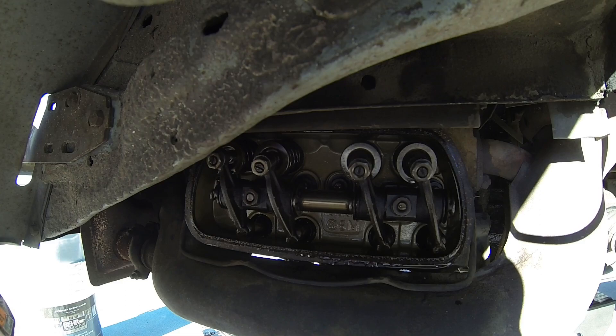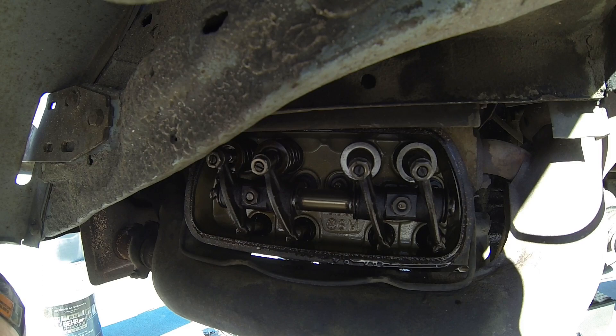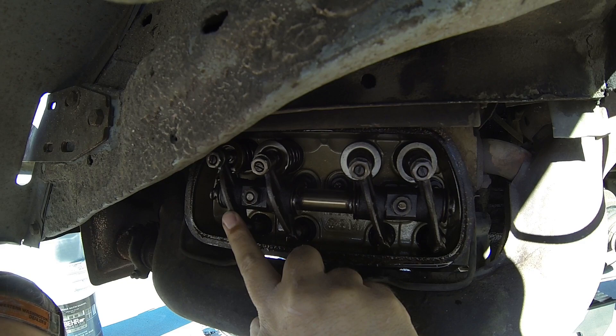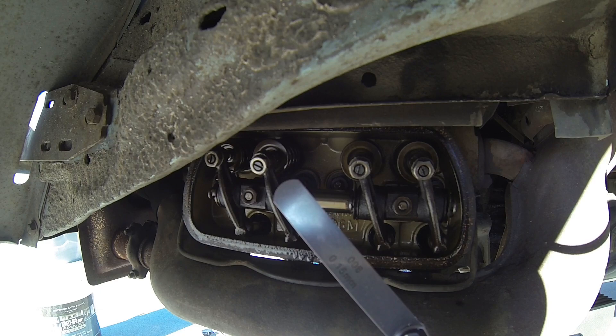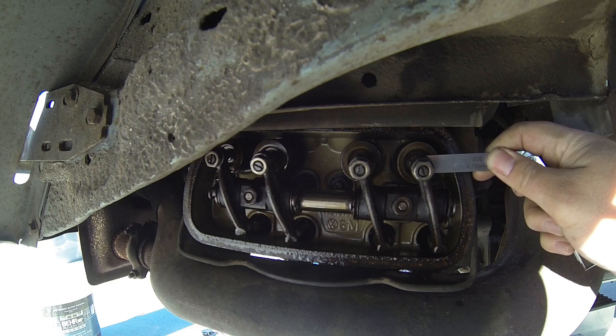As you may have noticed, this valve was rocking back and forth. That was because I was rotating the engine before and after top dead center. I was watching the video feed from above while rotating the engine. So now we know it is top dead center — this one is rocking, which means we're on top dead center. I validated because there's a notch on the pulley lined up to the center of the block. So we have a feeler gauge here set at six thousandths — that's 0.006.